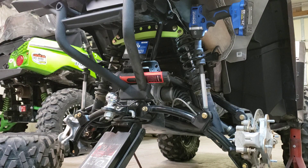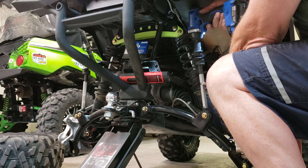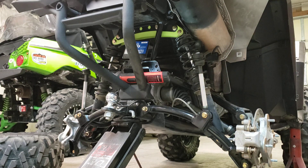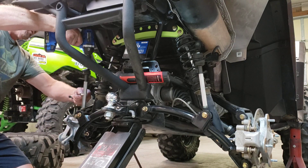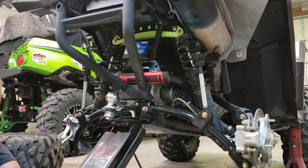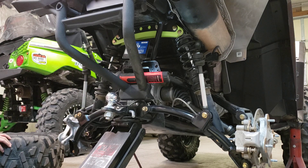We're going to get a wrench and just give them a nice good crank down. I don't know if there are any specific torque specs — I just kind of go until I get that rubber squished out again. Put everything on. You'll still have a couple of old bolts you don't need: your sway bar bolts — you replace them — and your shock bolts; you won't use those again.